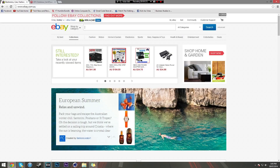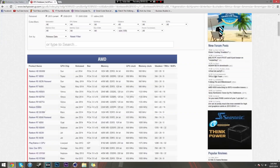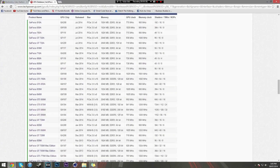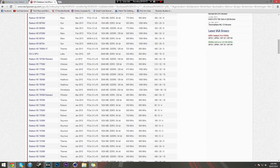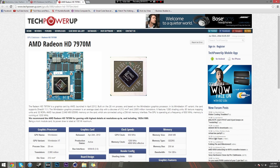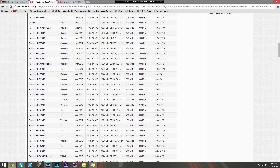Before you even look at this video, make sure you look at the first version. You go to this website - link will be in the description - and you check whether you can upgrade or not. The number one best way to check is you look at the bus. If you have MXM B or MXM A, just like that, you click the card and you can see the legit card right there, then you can upgrade.